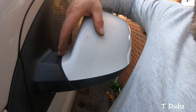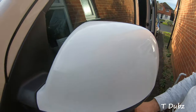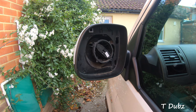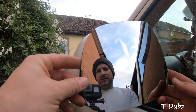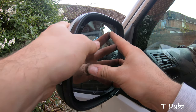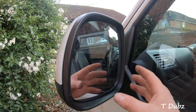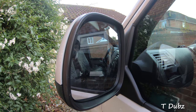The cap's back in position, it's all snug down here. There's a little bit of rubber there I could probably poke inside if it needs to go in. Now the last step for the wing mirror fixing and fitting is just to pop the new glass into place. New wing mirror glass going in — give her a good push but gently so I don't break the new glass, and she's in. All that's left now is to get in the van and check it's at the right angle so I can see what's coming up behind me — cyclists and so on — and see the curb so I don't damage my new wheels.